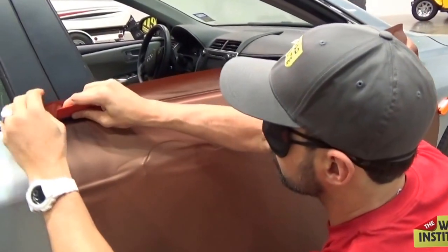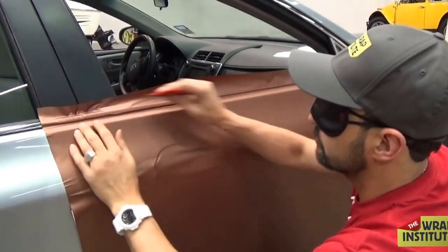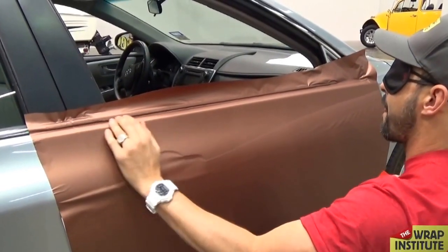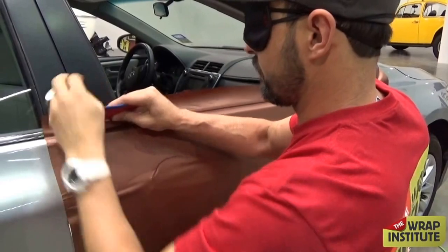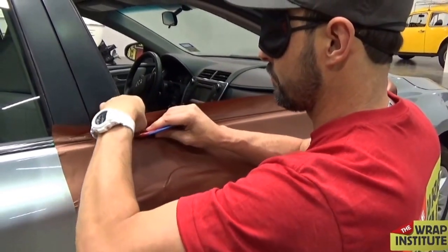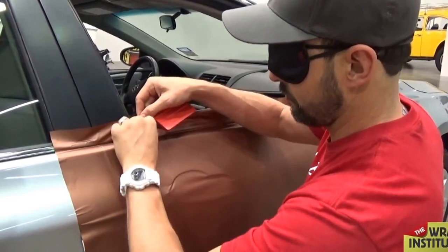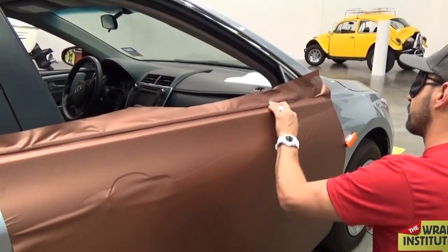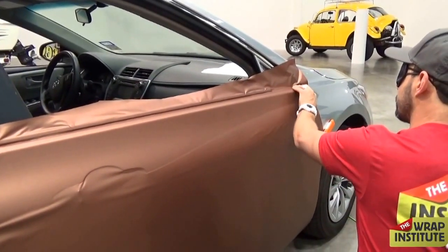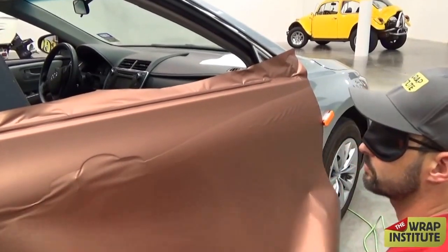Knifeless tape is really key for that area, especially if you're a beginner or intermediate. I felt some wrinkles right there at the edge, so I pick it up and really want to get it nice and smooth on the knifeless tape. Doesn't feel quite smooth yet, so taking my time. Once I get it set up, pull it nice and even — and done. This is just solid fundamentals: not moving on until it's 100% good. Now that the top section's done, I feel through — everything feels good.